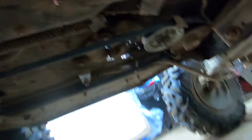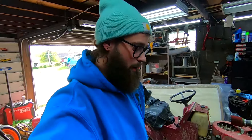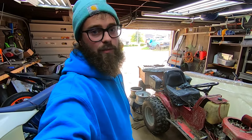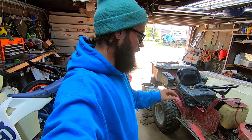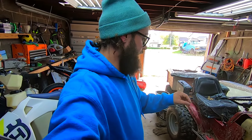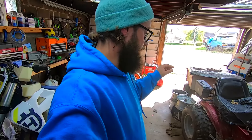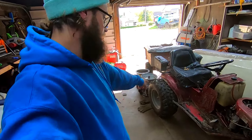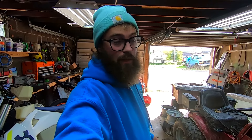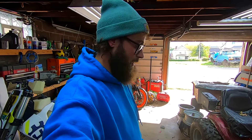This has pretty much eliminated the majority of my belt issues. I was going through a single belt every single ride with this mower — or one to two rides — and then I had to replace the belt. My clutch spring is not nearly as tight as most people's, along with this being a high horsepower motor, and the D-Stone Swamp tires are a lot more aggressive than these trail pros. So if you get on it, the belt's going to slip. But after I did the holy pulley mod, I can get this thing to rip in the mud with very minimal slip.